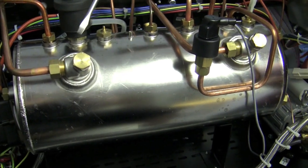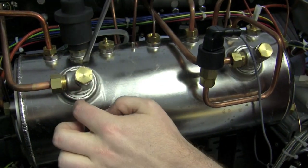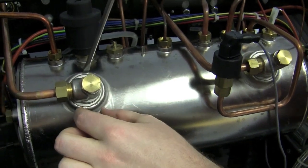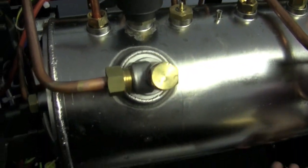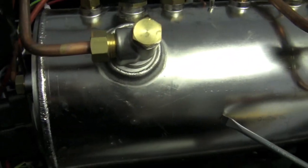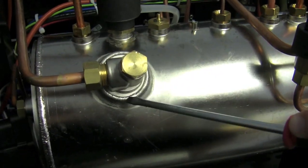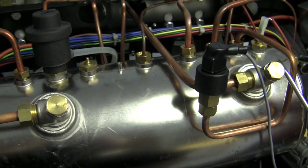These two protruding things are what's called your heat exchangers. We've gone over this before, but again it's a cylinder — you can see it really well here. It's a cylinder right there that's self-contained, it goes all the way through, and all the way at the bottom that comes right out so you can see the same one underneath it. That is completely self-contained, so the water sitting inside this boiler is not the water sitting inside that tube.